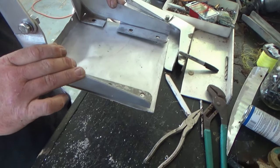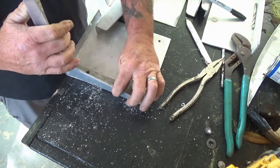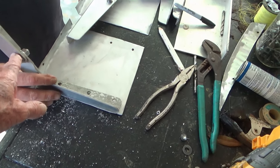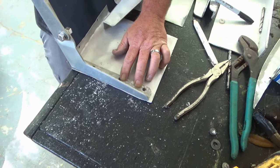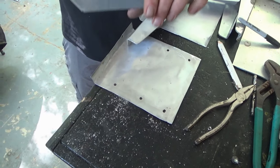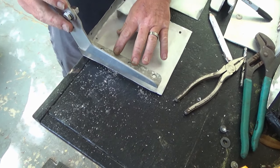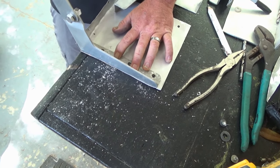If you want to adjust them, we'll get that turnbuckle situation and mount it here to here like so. The thing with adjusting them — that's why I went with nuts and bolts — the old school step and trim, that's all it was on both sides: nut and bolt. If you wanted more adjustment out of them, you just take a grinder and cut the lip down right there. Then you can adjust them further down in the back instead of whatever this is already preset at. If this isn't giving you enough lift, you just notch this back piece down some and that will come further down.